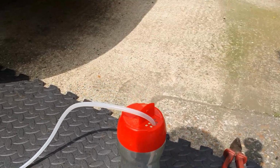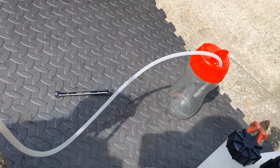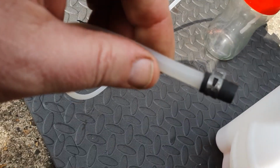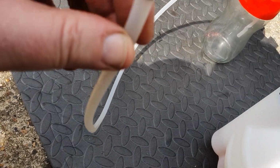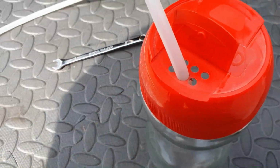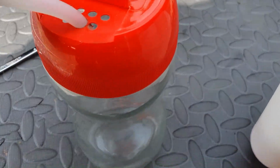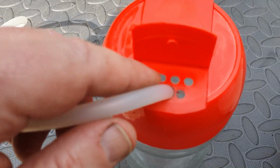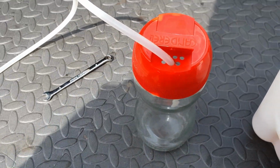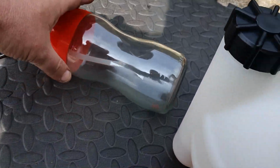Now what I've also done is I've purchased about 1 metre of silicone tube, made a little adapter there with a clip that we can get it to clamp onto the brake caliper nipple. And also I've used this, what was a sweetener jar, and quite conveniently it's got nice little holes in the end there. So I've just put a large one and poked the tube through there, so that way we can catch all the fluid, and if that falls over, hopefully we won't spill too much.